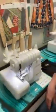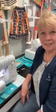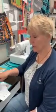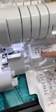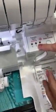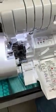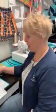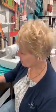Do you clean all over on the machine? I really just clean that one little spot. If a machine isn't working quite right, it should be serviced about once a year because there are things inside that they'll need to oil — even if you don't use it, because the oil will coagulate. But right here — big words: do not oil. Don't put any water, don't lick your threads, don't put any oil in there, nothing. If you lick your threads, that moisture will get down inside those pipes and you don't want that. You don't need to lick them — you're not threading through a needle.